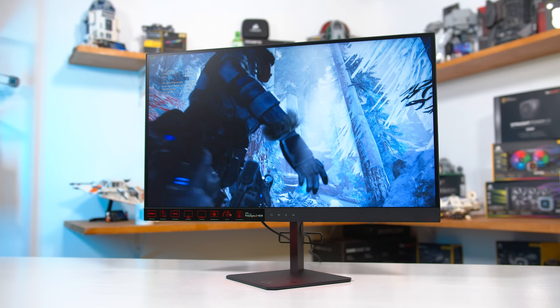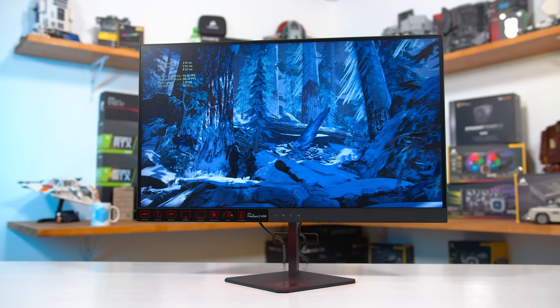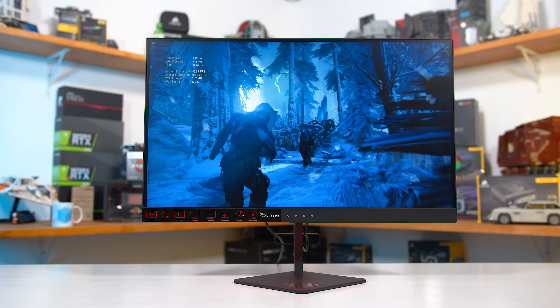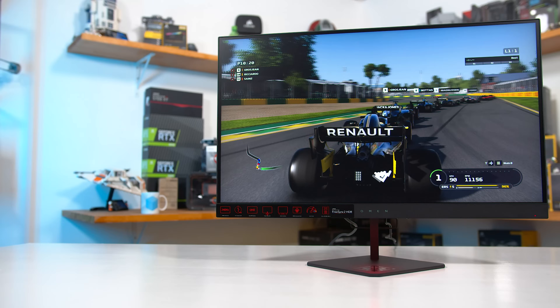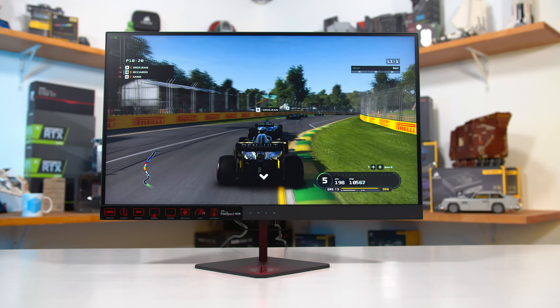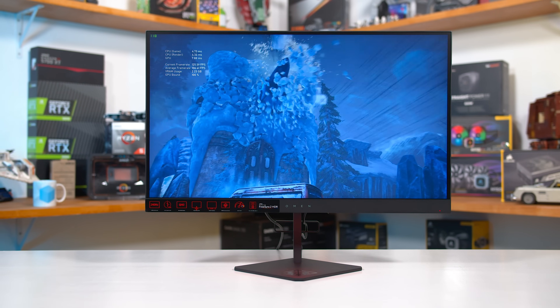Speaking of the refresh rate, let's talk about the combination of 1440p and 240Hz. Adaptive sync works with AMD and NVIDIA GPUs with low frame rate compensation. The big question is whether you can actually run modern AAA games above 165fps in 2019. Even with a GeForce RTX 2080 Ti, in the most demanding titles you're looking at 100–140fps at ultra settings at 1440p — enough to max out a 144Hz display, but not enough to make a 240Hz display worth it for games like Borderlands 3 or Star Wars Jedi: Fallen Order.